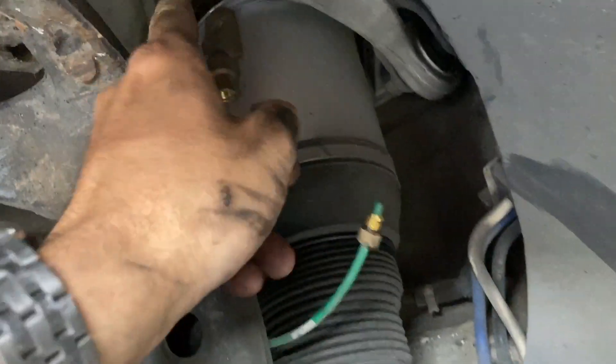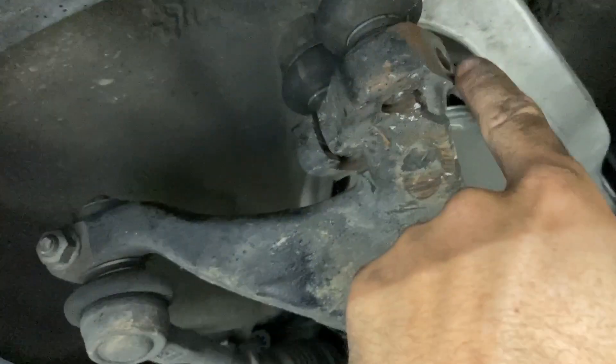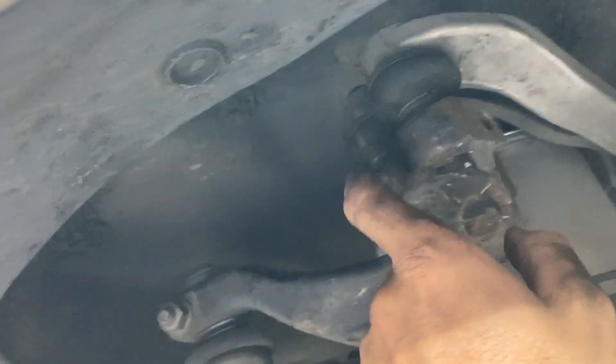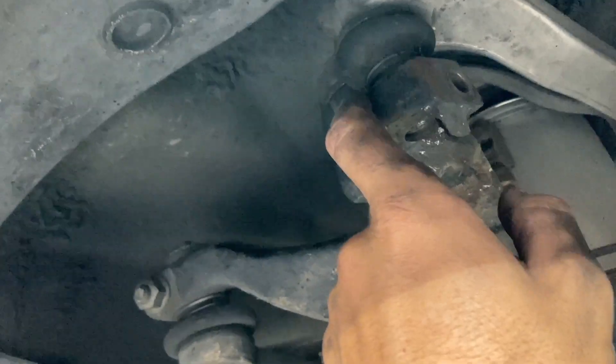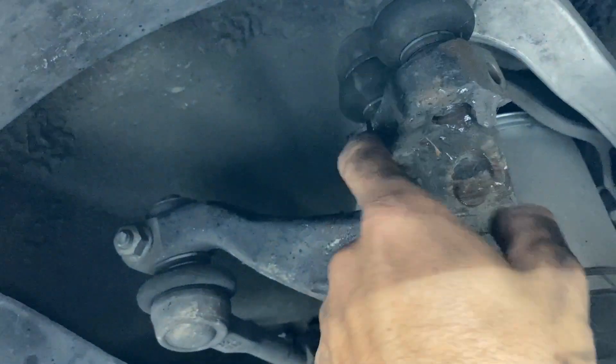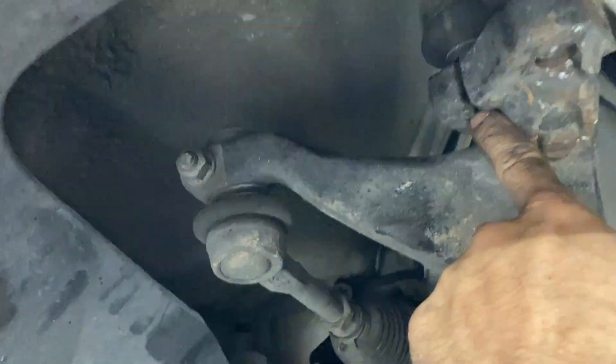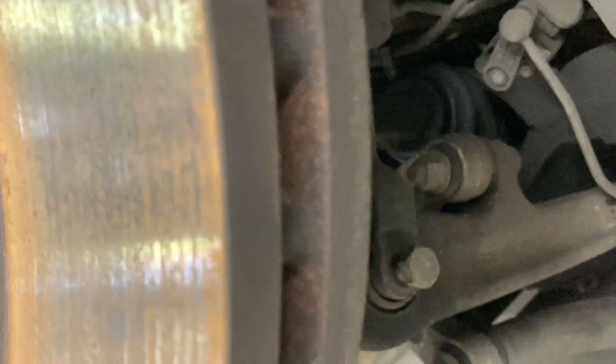I'm using a 10 millimeter wrench to take that off and get this piece apart. With this fitting, make sure you first knock the bolt out — it was a 16 millimeter. Remove the bolt first; these seem to have a slot in them because they move very quickly with the three-jaw puller and air hammer right after removing the bolt. Do that first and you'll be on your way.